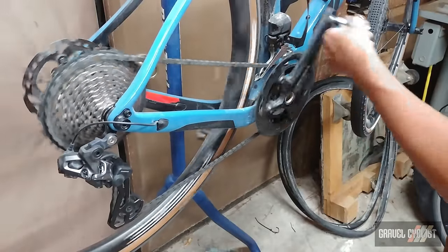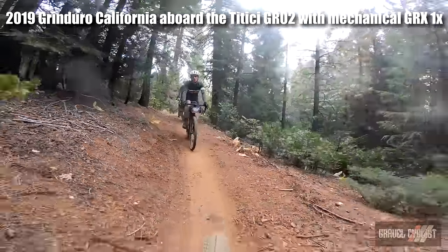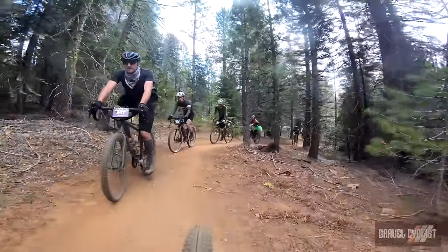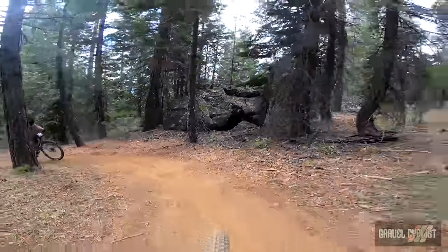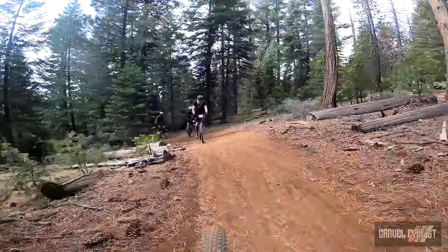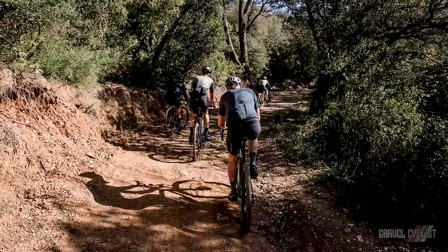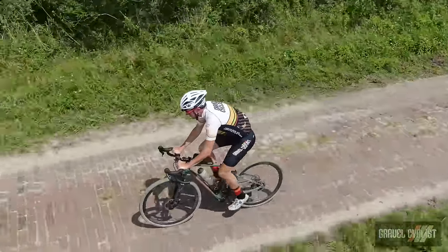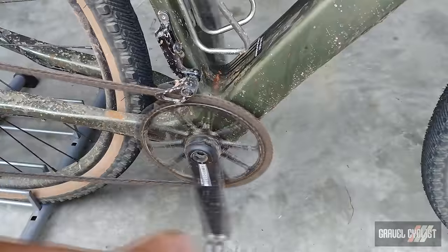If the 2x-specific mechanical rear derailleur is like the Di2 version, you can shift all the way beyond a 34-tooth maximum cog to a 40-tooth cog. The big negative I don't like about 1x gearing is its limited range — 11-42 is the biggest cassette recommended, whereas I think 11-46 would be a great option. You could run an XT derailleur — at least the Di2 variant — to solve this somewhat limited gearing problem. I felt first-hand the limitations of a 42×42 and even a 40×42 low gear when I had to walk the Titici GR02 at Giro Gravel California and the Specialized Diverge Di2 1x in Girona, Spain because the climbs were very steep. This system also works great with the Easton crankset with 47/32 chainrings. Just plan your gearing wisely.